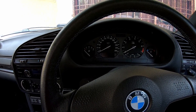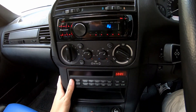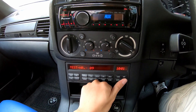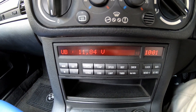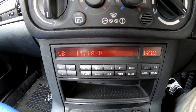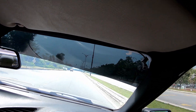I left the car overnight and let's see how much voltage remains after being left overnight. Oh, this is not good — the battery is having low voltage. Does it start? Oh yes, it starts, but it's not good; the voltage is quite low. I took the car for a little drive around and the performance just feels sick. I believe the battery itself has depleted below 12 volts because of the high discharge rate of the supercapacitor.